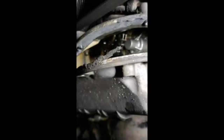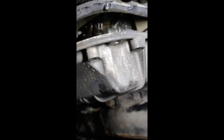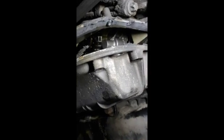And that RTV, which is Mercedes-Benz original, by the way, they say that's really hard. You got to warm the engine up. This engine's stone cold. I did not warm this up at all. A few taps with that chisel in that spot right there, and it came right down. Wasn't hard at all. So I'm going to twist it around and get it out from under there.